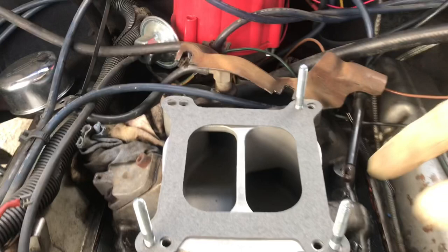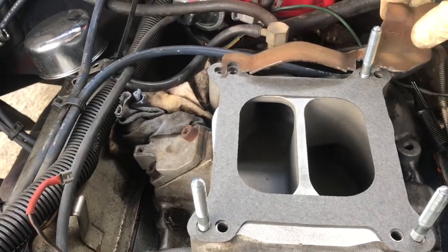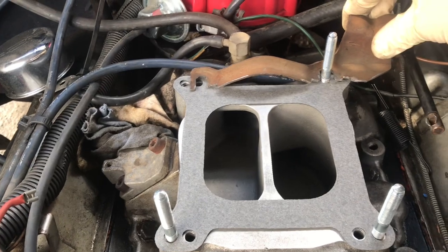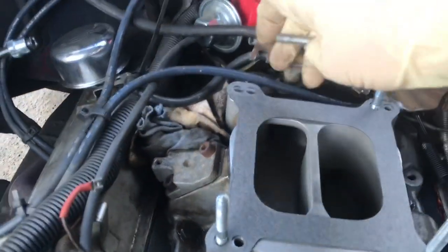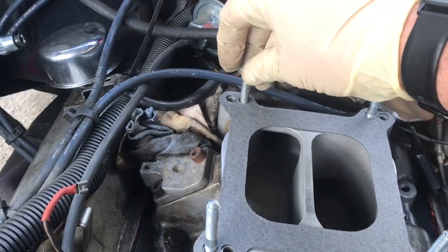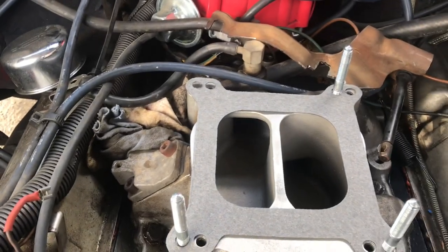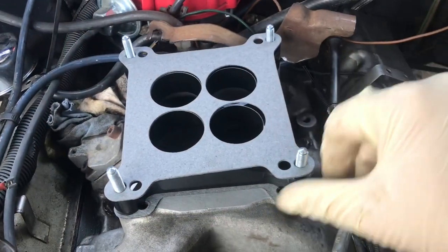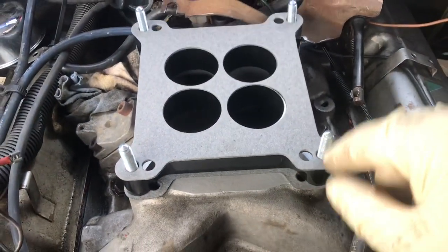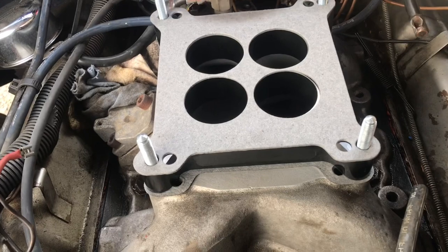After reviewing the tape, I realized I used the inner holes. Why was I using the outer holes? I don't know. So that stud is screwed up — that's why I remember I had the bolt. I'm gonna reassemble this for the 50th time. Here's the issue: the adapter doesn't have the inner holes. Only the gaskets have the inner holes, so I could bore out the adapter.